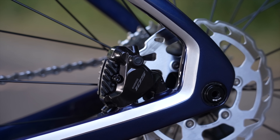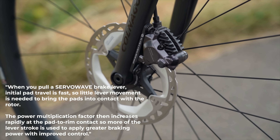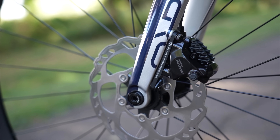There's also a small difference in braking performance. The new Ultegra has a servo wave, borrowed from GRX, which is basically a non-linear brake action. When you first pull the brake lever with Ultegra, the pads move faster relative to lever travel to bring the pads closer to the bite point, ready for a hard squeeze in a corner — giving a really nice light modulation feel. You don't get that on 105 Di2. But riding both bikes on the same course and hills, the difference is very slight. You can feel it if you really look for it going from one bike to the other, but I wouldn't say I absolutely need it.